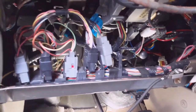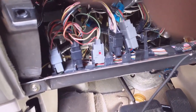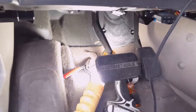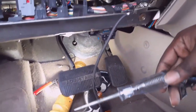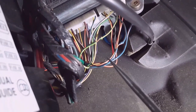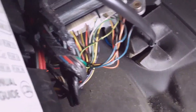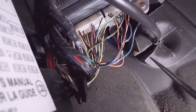I want to show you how you can find your door locks and wires. What I have here is called a test light — you can also use a multimeter. I prefer a multimeter but the test light is easier right now. Take the clip to ground. You want to go up under here — usually you have type B locks which are negative. Right here is a light green with yellow and a light green with orange — those are your door locks. When you take the test light to negative and probe them, with type B locks the locks will jump.